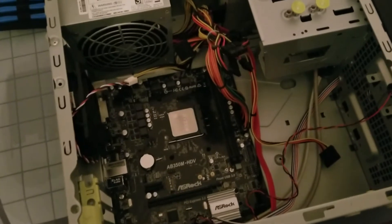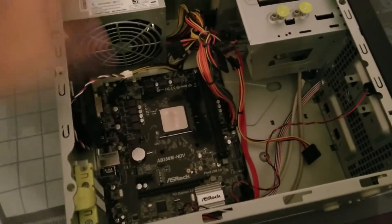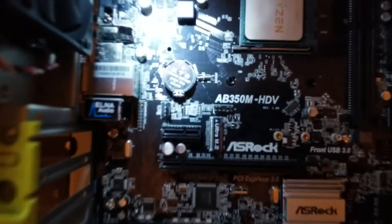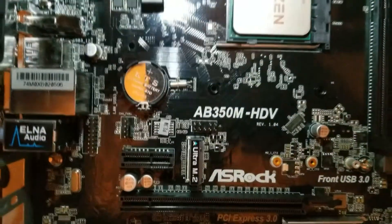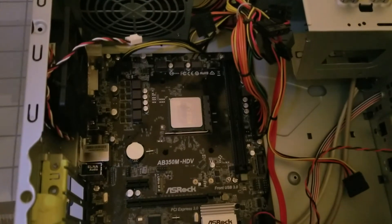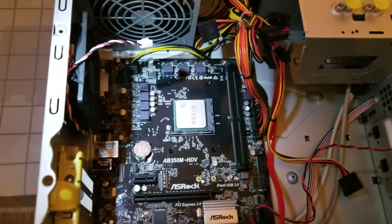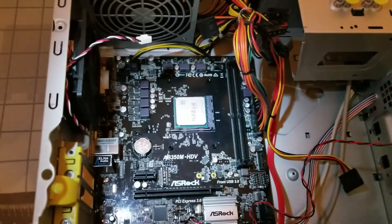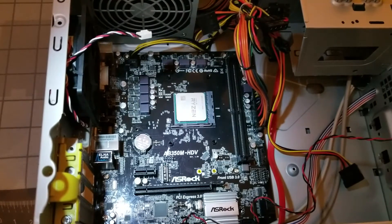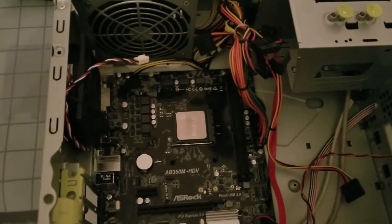This video is not going to be ending on a good note. The motherboard here has BIOS P2.30. Besides YouTubers who got review samples with updated boards, a regular consumer who already has an AMD board and Ryzen processor can update their BIOS and they're good to go. I'd obviously recommend updating the BIOS before putting in this CPU — because right now I'm not getting anything on this board; fans will spin but nothing happens.